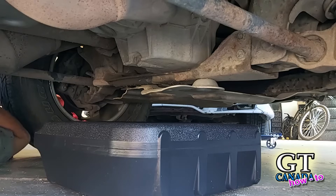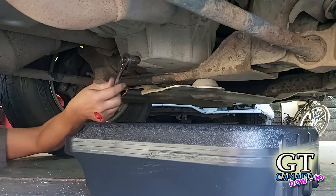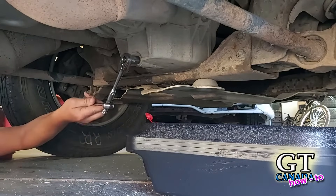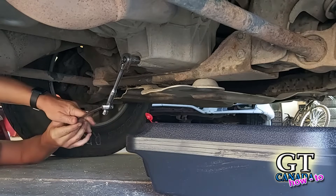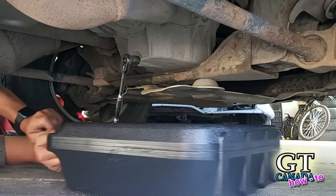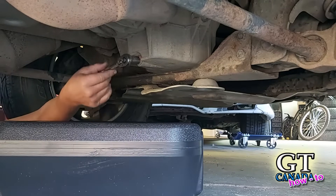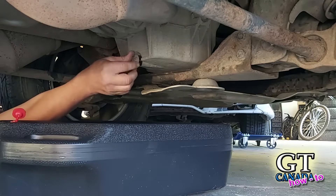Make sure you've got a good drip tray to catch your oil. If the drain nut is too tight, you can use a wrench on the back of your ratchet to get a little extra leverage. Be careful though — if you're doing this right, your engine is very hot. Your oil should be at operating temperature so it all runs out easier, which means the exhaust will be hot too. You can see I'm trying to avoid hitting the exhaust — there's exhaust coming down both sides of the underside of the truck. Just pop it off and let it drain out.